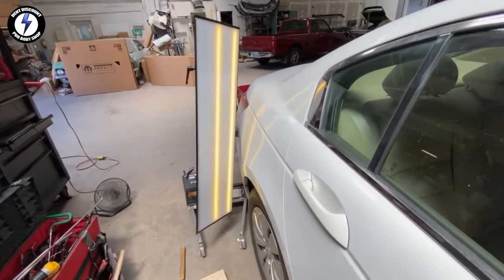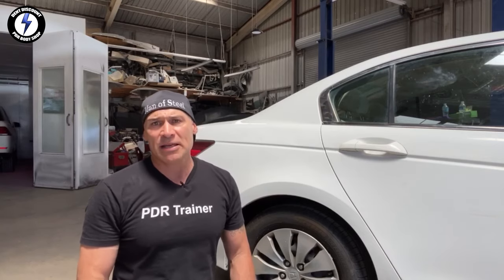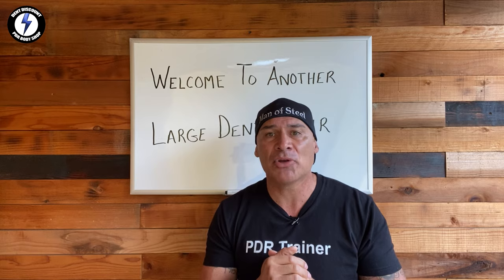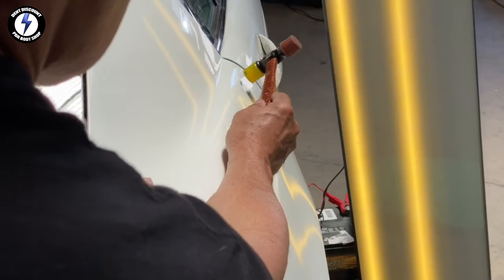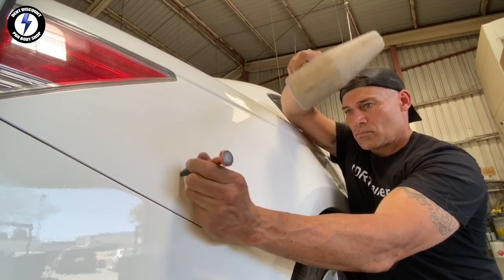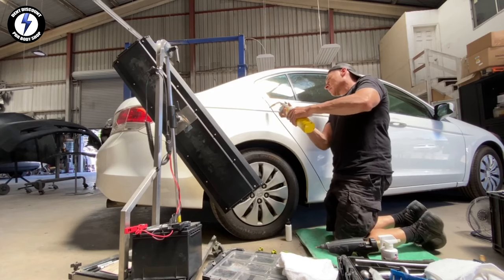Let's take a closer look at the results and see the remaining damage. The large damage is shaping up really nice. What I'm going to do next is knock down some crowns around the dent, then do another round of pulling with my PDR glue tabs. Step number five: I'm using a variety of knockdowns and hammers to blend the crowns back into the dent and into the panel, addressing every high spot in order to restore the shape back to its original factory finish.